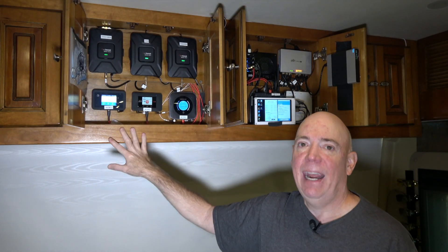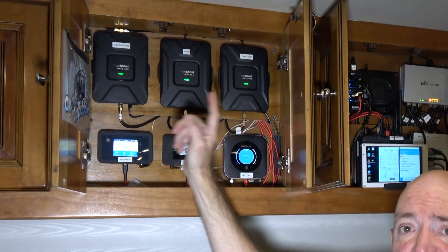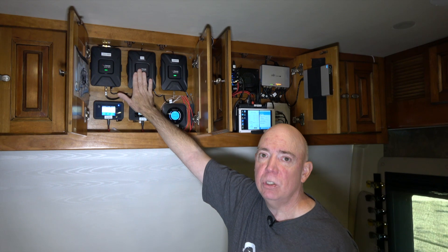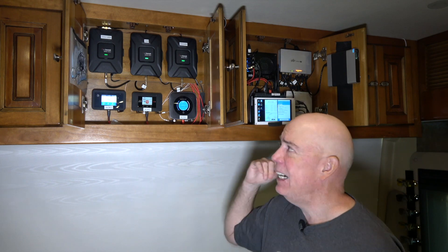We can clearly see that using boosters directly connected by antenna input to your jetpacks can greatly enhance throughput — that's a really big speed increase. I'm not expecting everybody to do this since these were $500 each, but if you have a WeBoost system and you're wondering how to get the best data on the road, consider connecting your WeBoost directly to your jetpack — you may see performance increases like this. I'm Dave Bott from OutsideOurBubble.com. If you like what we do, please click subscribe. We bring content when we find something helpful for fellow RVers and coach owners. Take care, keep safe — see you on the road.